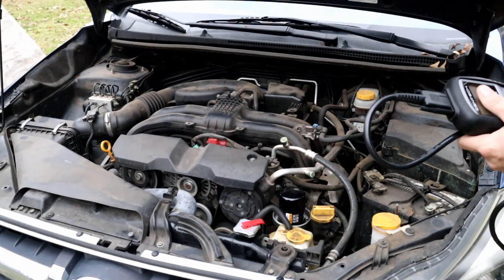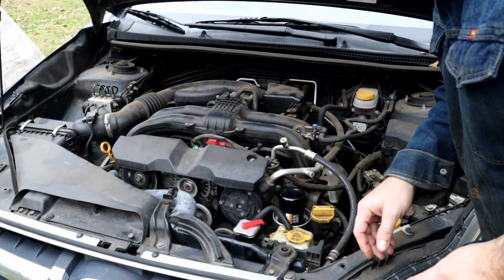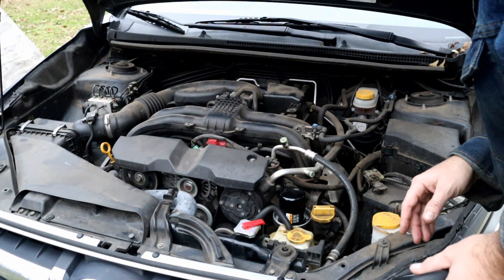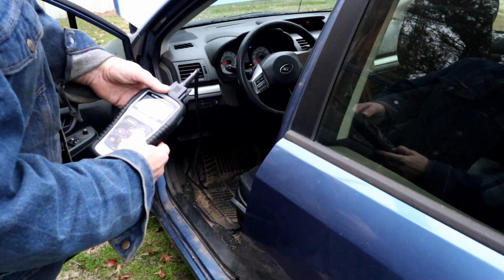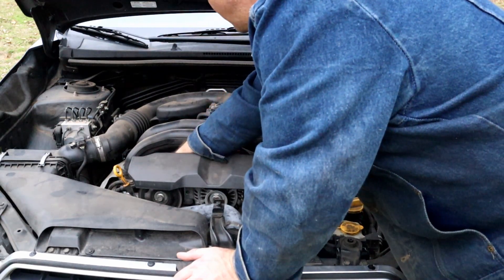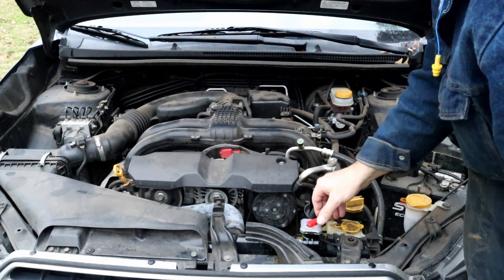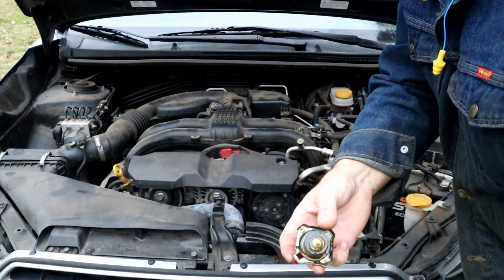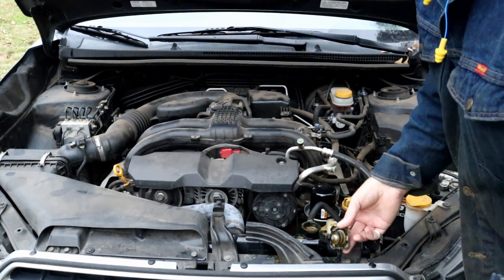Let's take a look at the car, start it up, and look at the coolant to see if we can see anything — come up with a plan. So here's the car running. Like I said, new radiator, new upper and lower rad hoses. The only code showing is camshaft position slow response bank two. Just the one code. Engine oil's fine — I just changed the oil. I've got oil in the antifreeze. That would tell me there is a head gasket issue, but it's overheated beyond overheating.